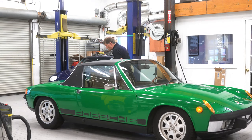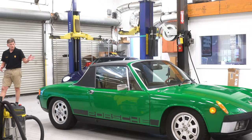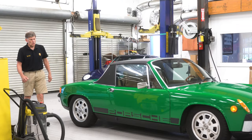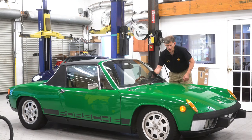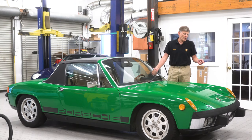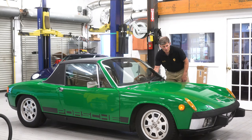Make sure the engine grill is not going to pop up. Looking at the stance of the car, I see the rear has some negative camber — the spec is 30 minutes negative camber, and this looks like more than 30 minutes, which is not bad for handling but will affect tire wear. Front should be zero camber, which it looks like it probably is, though it's a little low. When the car gets low, the camber increases in front and makes it harder to steer. Also notice the curb light — with the key in your pocket, it works dependent on whether you're pushing the right or left turn signal. It's a warning to passersby that your car is parked on the side of the road. All European cars have this curb light, so don't think there's something wrong.